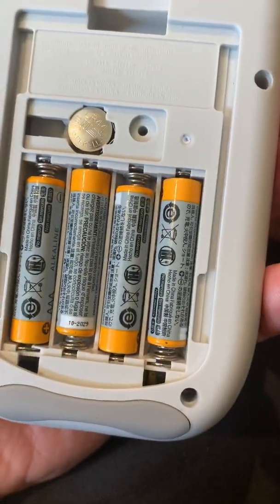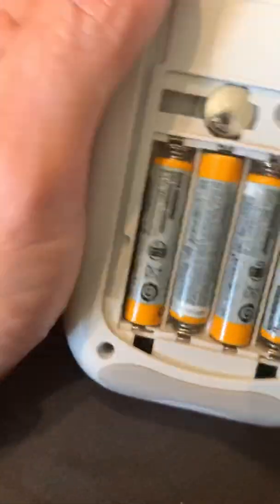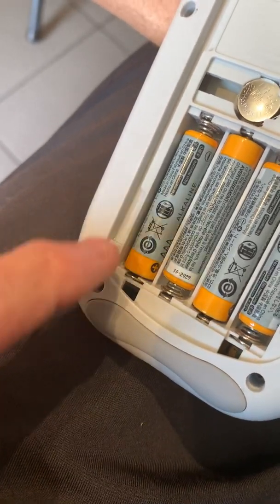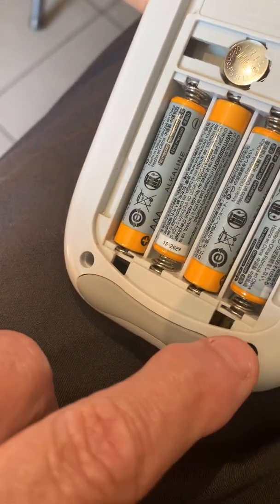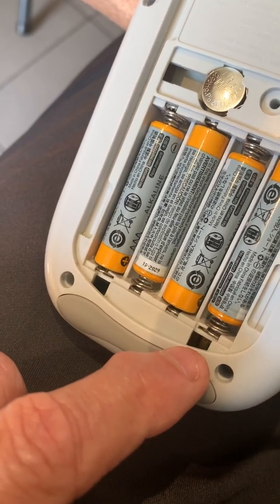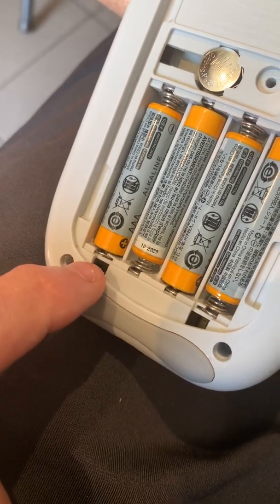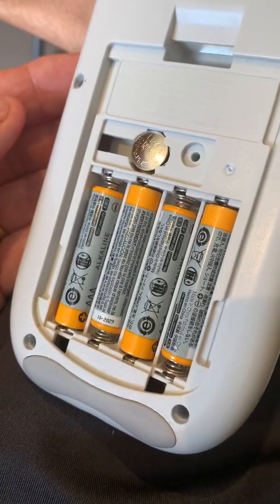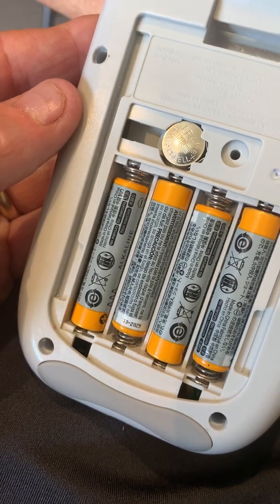I even took the back panel off and checked the contacts, which you can see in these two holes here — there's some contacts down there. This one comes from this battery and this one comes from this battery, but those are the two contacts that these springs are connected to — a little metal spring down in that hole that presses against those contacts. That seems to have been a lot of the problems people have with the power not coming on in this thing. Those seem to be fine, even though I cleaned them off.